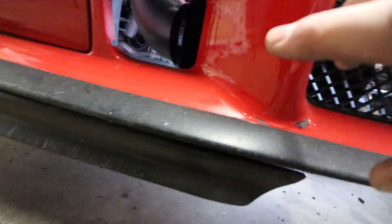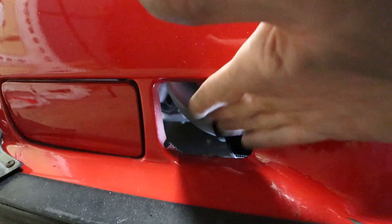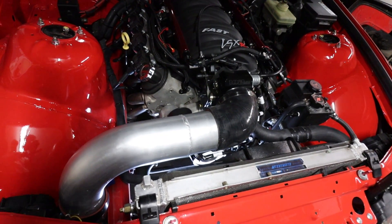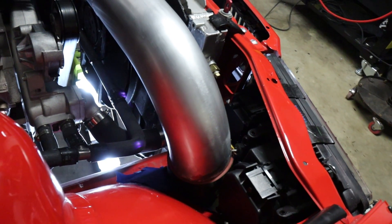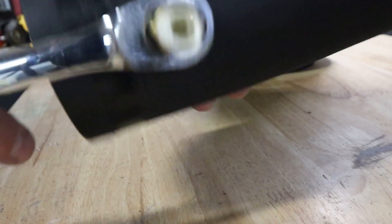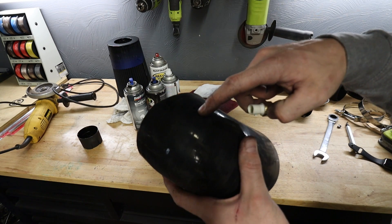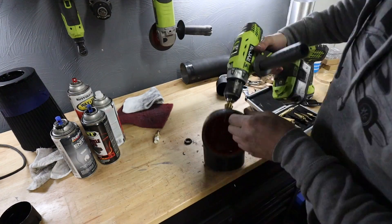I'm pretty happy with that. It might not be the final position, but it should be drawing in some nice cool air. The way everything is set up, it can't quite just stay in the fog light — the pipe is too close and the filter is too big, so it would push the bumper out. The only thing I don't like is that chrome ring; I'm probably going to paint that because it looks like crap. I'm extremely happy with it overall. Now I need to paint that ugly chrome ring, wrinkle black all the piping, and get it fully installed. Oh, and I've got to figure out where I'm going to put my IAT sensor — I did want to move it so it's not reading hot radiator air. I'm going to put it in the silicone boot this time, since silicone doesn't retain heat like metal, so hopefully this gives a more accurate reading of the actual intake air temperature.